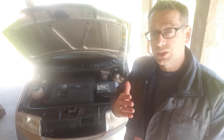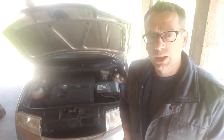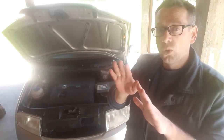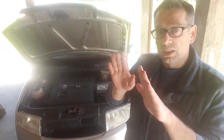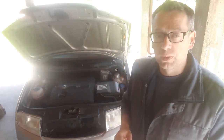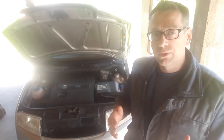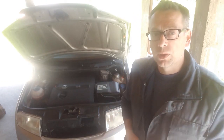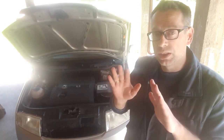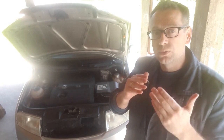that there won't be a smooth start when releasing the clutch pedal. If you've driven a car with a manual transmission, you'll know that there is that sweet spot, I think it's called that way, where when you release the clutch pedal and add the accelerator, the car smoothly drives off and there's no problem. If everything is okay, that's the way it's supposed to be. But when the DMF started to wear out and cause problems, that sweet spot wasn't there. Every time you released the clutch pedal, there was sort of a jittering feeling, and the engaging of the clutch wasn't as smooth as usual.